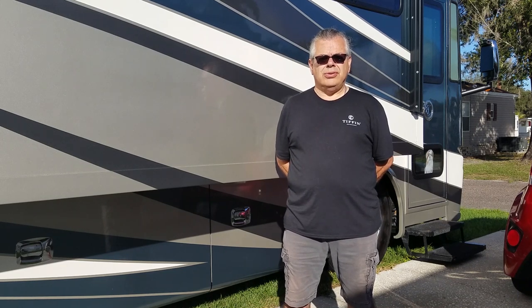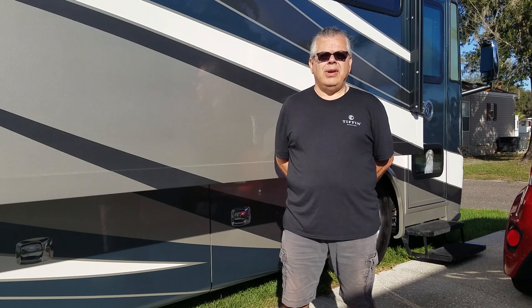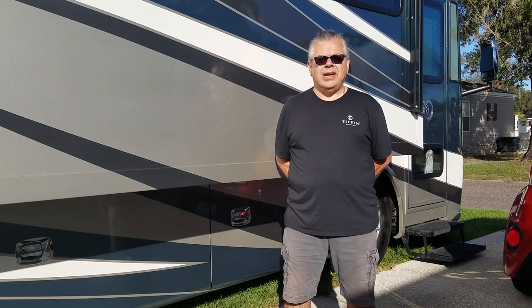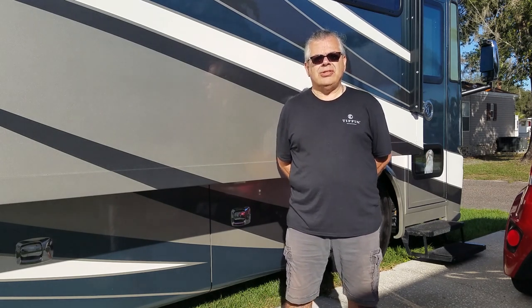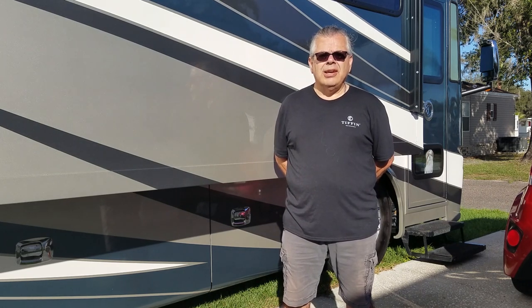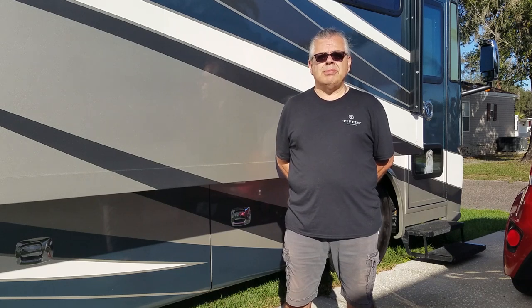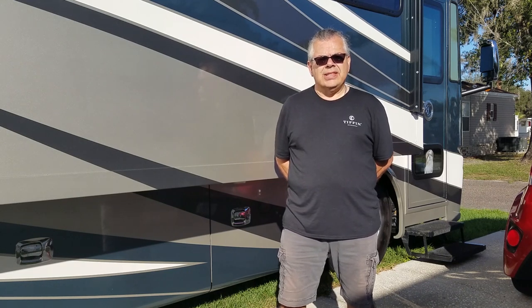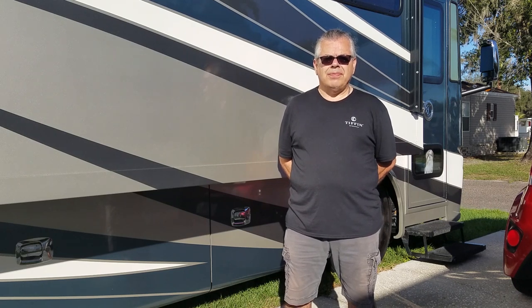The second method is dolly towing, where you pull your vehicle up onto a two-wheel dolly and strap it so the front wheels are off the ground. That's great for most front wheel drive vehicles. There are some disadvantages — it's more difficult to see where you are, there are more parts to manage, and you have to stop periodically to check that the straps are tight and the vehicle stays secure. What we chose is called four-wheel-down towing, dinghy towing, or recreational towing — all four wheels stay on the ground. Ours uses a Blue Ox tow bar and a Blue Ox base plate on the front of the vehicle.